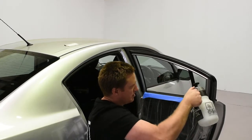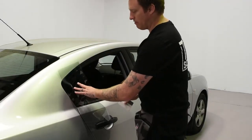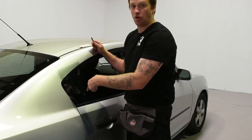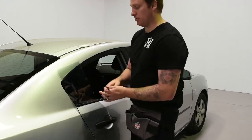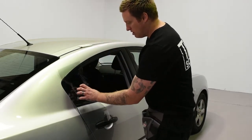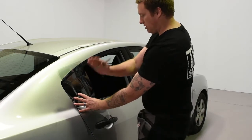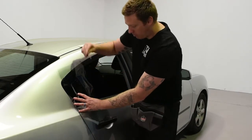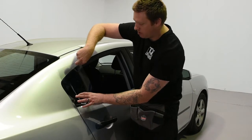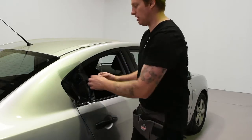I'm going to flush our leading edge or front edge and it's clean, ready to cut out. You'd lock the window on, but if we want to move that film around we'll just leave it. You could cut templates using your knife on the clear sheet to get the exact shape, or use a marker and take it away to cut it. With my finger I'm just finding that lead edge — if I've got the glass, my nail and then the rubber, I want to drop that knife just in there between my nail and the rubber. When cutting up, I'm putting pressure outwards, not cutting in, and not pressing too hard.